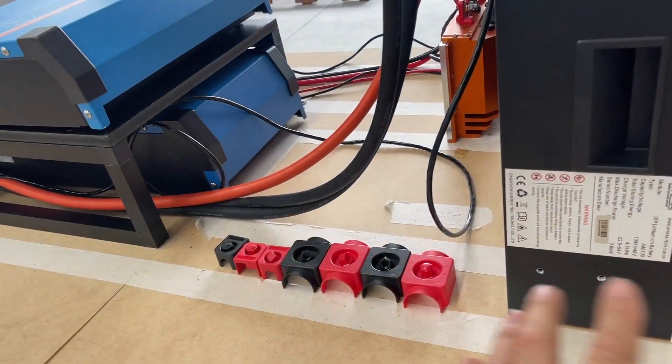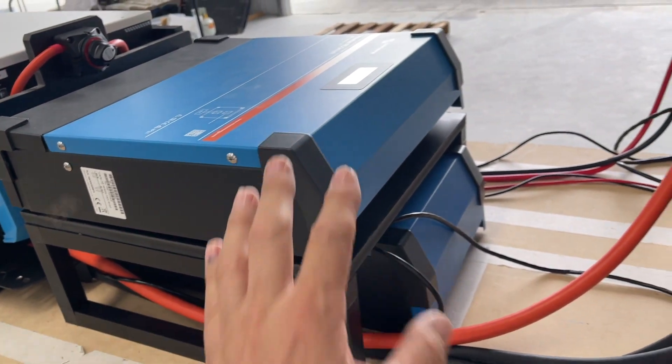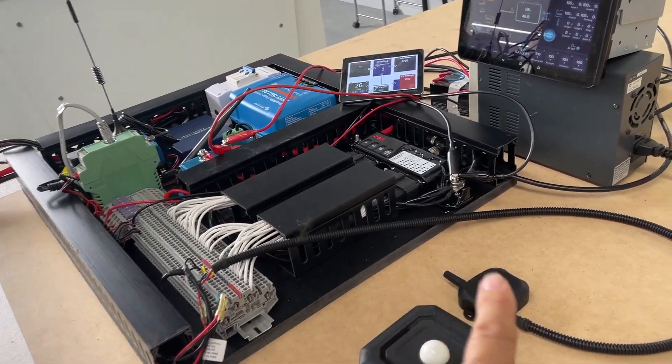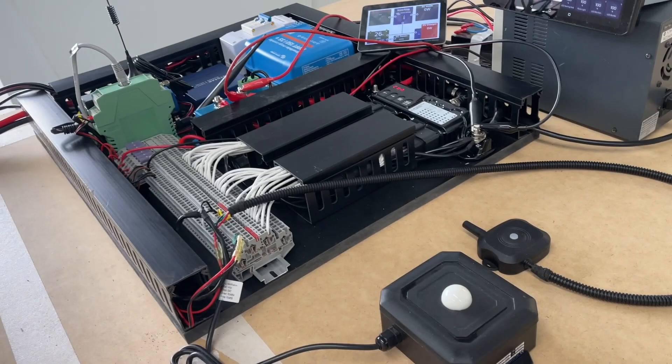It's all within the area we've got in the Crafter — this is in the rear garage, all under the seat. This is a total of 6000 watts of inverter and inverter charger, and 1200 amp hours of lithium, running at 3000 watts, along with all the digital switching, TPMS, and auto-off on the lights at night.